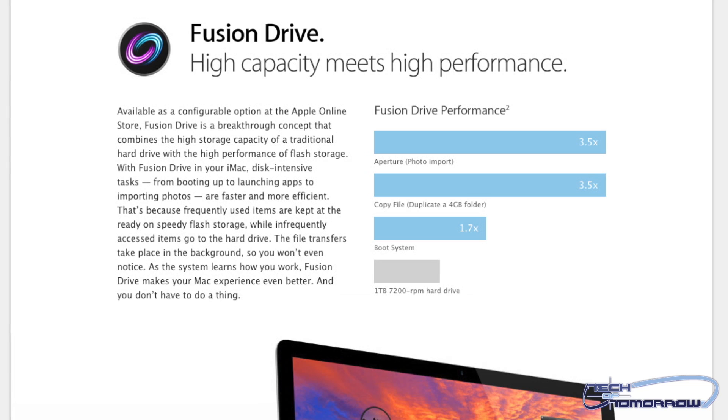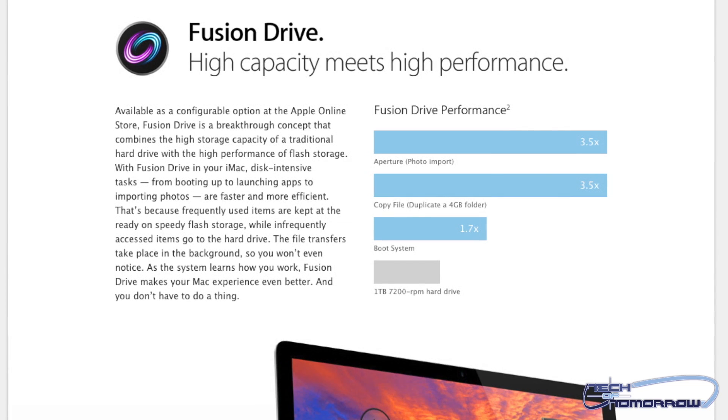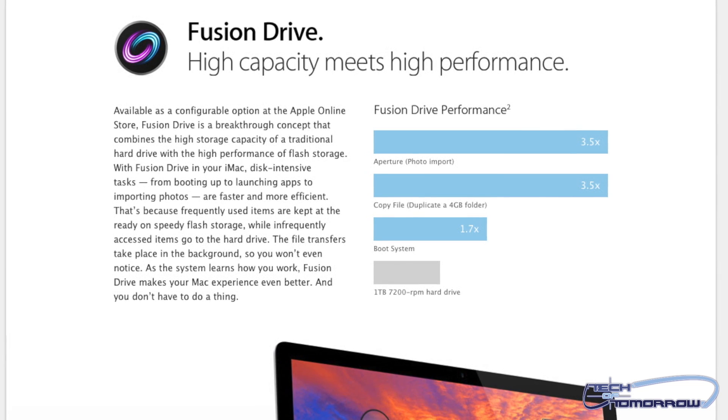Now I know there's been a lot of controversy out there and a bunch of talk about this thing — what exactly is it? Now for the last year or so, we've had Intel's latest Z77 motherboards. They all feature Smart Response Technology, which uses a hard drive and then an SSD as the caching device. So basically, the more information you access, the SSD spills over into it and makes things faster. Now this technology in the Fusion Drive is kind of the same principle, but it's totally different. Four gigabytes of information can first be brought through the SSD before even going to the HDD, and what's totally different is that the SSD is the first drive to be used.